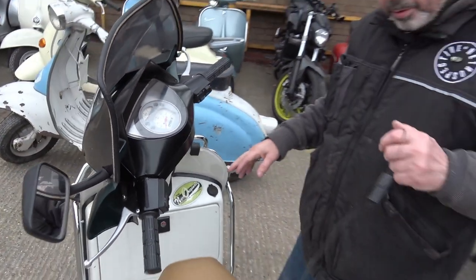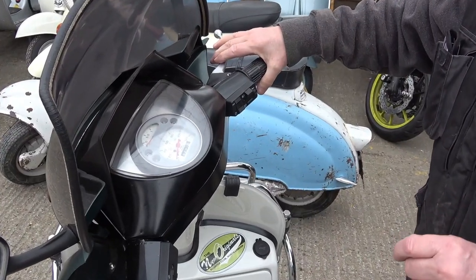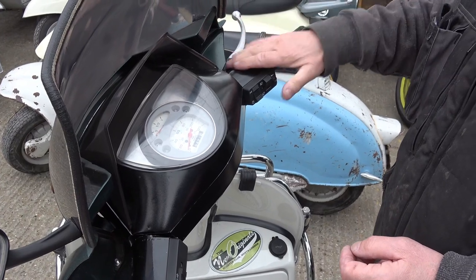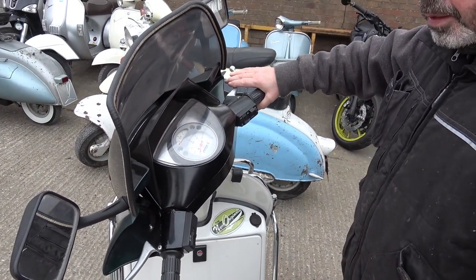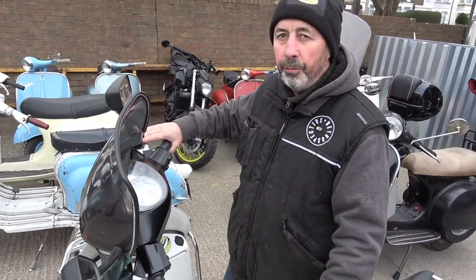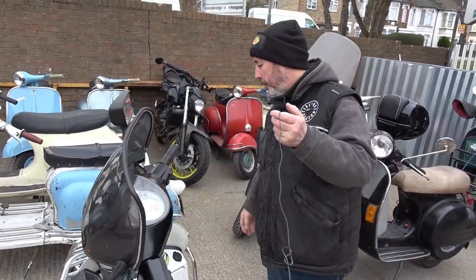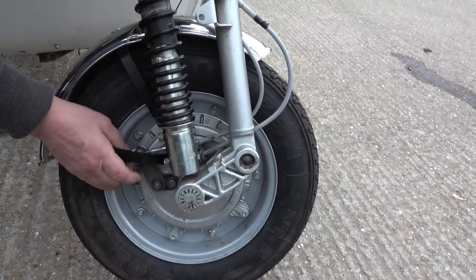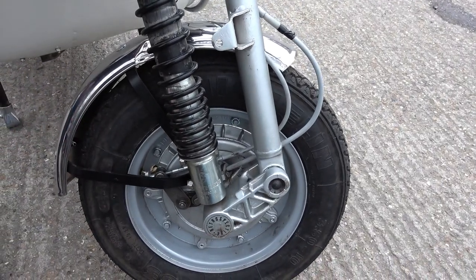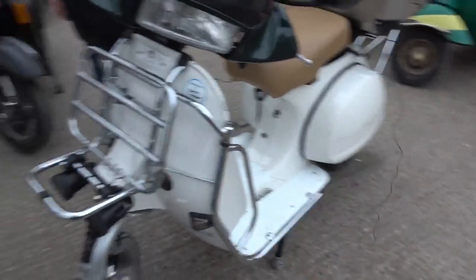Through the front brake — you may notice this is actually a 2003 PX125 with a 150 head on it — but we've done away with the disc brake. That's just for simplicity and maintenance reasons. The disc is something that if it goes wrong you've got to deal with fluid and change forks, and it's just messy. So it's cable operation: the old EFL setup with the EFL thumb adjuster down here, and it's got a drum brake system which is really good actually. If it's maintained well and set up well, it's a very strong braking system.